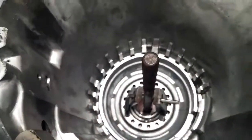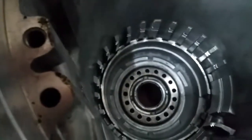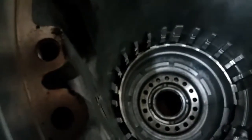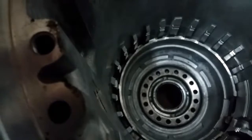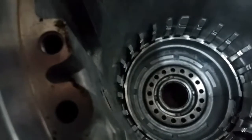Here's the Allen wrench and the two fork pieces. This thing sits on the shaft — this little pivot pin. I set it up in there and I'm done with that. This isn't in the videos I've been watching, but there's a port right here. What I'm doing is filling it with air. You fill it, let off your trigger, wait a second, let off your pressure — it's definitely holding. I got the rings right.